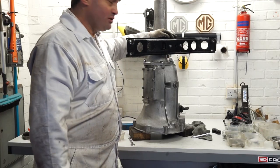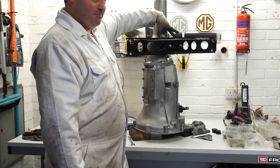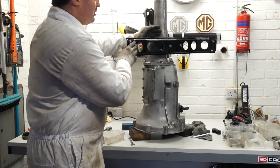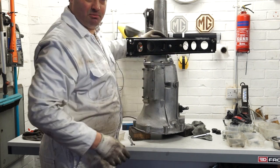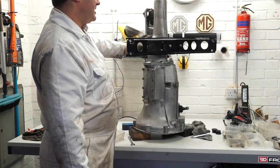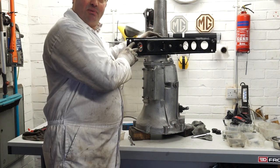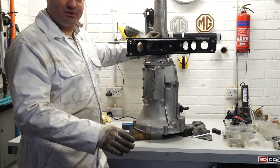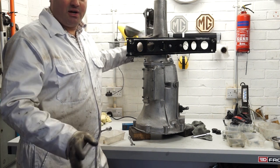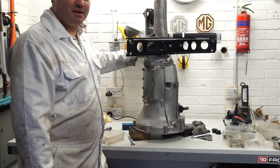So in terms of methods, it's all up to you depending on which one you'd prefer. Obviously with the slotted method there are some benefits - you can assemble a lot of this a bit easier, and you could do it off the car before putting it back in, if you've got the clearance to get it in. The more conventional method is possibly the one I use more regularly actually - just the gearbox dropping down when I put it back in. It does mean I've only got four bolts to do rather than having to take this all apart for the slotted method. I appreciate that having it on the bench here is an awful lot easier than doing it under the car. With this video, any questions please don't hesitate to get in touch, and as always don't forget to like and subscribe. Many thanks, bye.